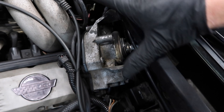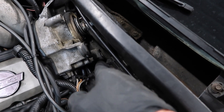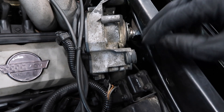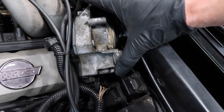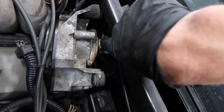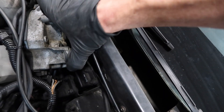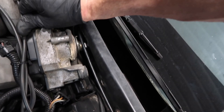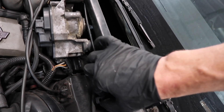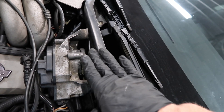I have the motor pulled out here. It's a really tight fit — the main motor part of this assembly hangs down at the bottom. I was able to get a pry bar behind it and slowly rock it out to where it clears the shaft, because it's so tight in there. I also unhooked the hood release cable bracket just to give a little more room, since the cable was holding down on the top.